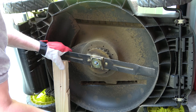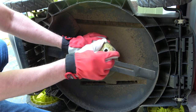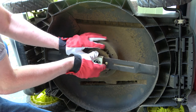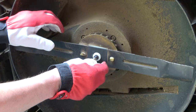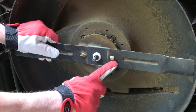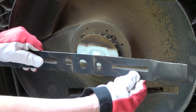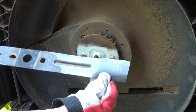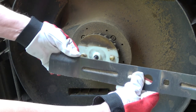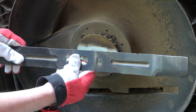Once that is off, you have a rectangular piece of metal that comes off, then a piece of plastic — note the orientation of each one. Then note how the blade is attached. There are two little points that stick out: one is rectangular, the other one is a half circle. So your blade will have to attach the same way. Note which side of the blade — the cutting side — is going up and on which side it's going down, so that you can mount the new blade the same way.